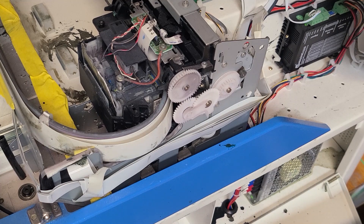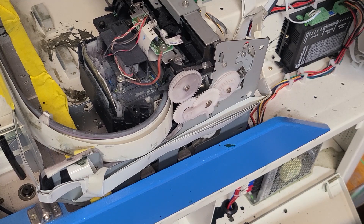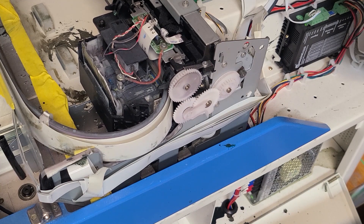Now in the morning, when you turn the printer back on, it's going to go side to side. You want to make sure that there's no liquid still sitting in the wet cap station, because it will stick to the bottom of the printhead — little bubbles. You go to print your first garment or your first DTF transfer, and it's going to leave a nice streak right across it, because it's literally just dangling from it. Safe bet: run a head clean in the morning before you start printing. That will make sure that everything out of it is gone.